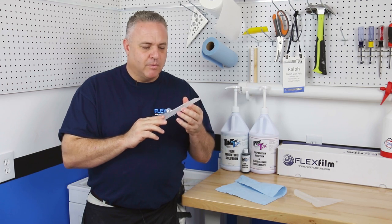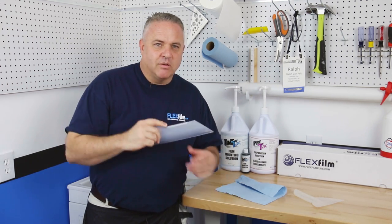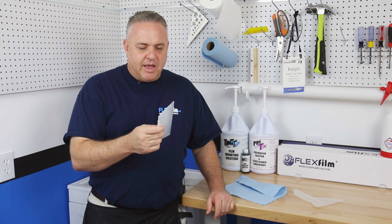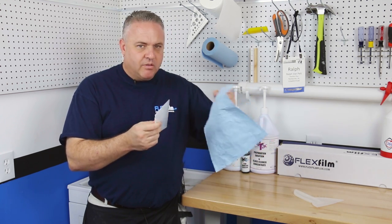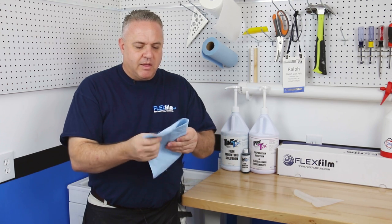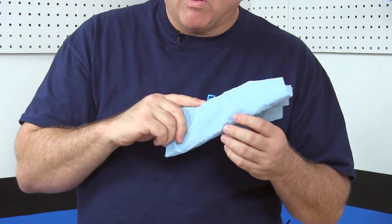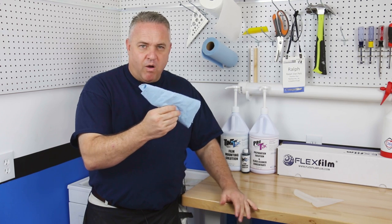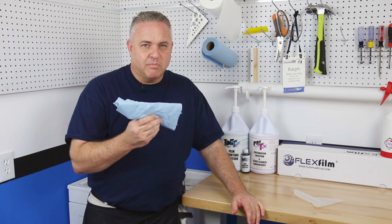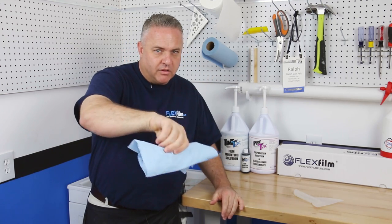I've never had this tool scratch any film, but I can actually take this tool and do a final pass on the bottom, and I can also do the same thing on a front windshield. I also like to take a paper towel and put it over this tool, and I can soak up that extra moisture in these hard to reach places. I can also use this tool just to bump the edges on all the perimeter of front windows and back windows, and it covers a lot of space. It kind of goes quickly for me.